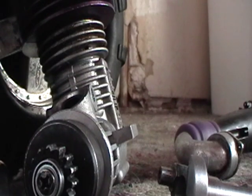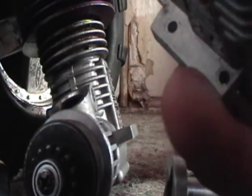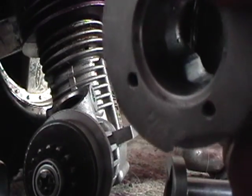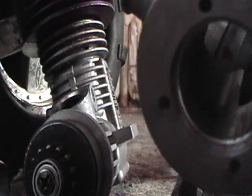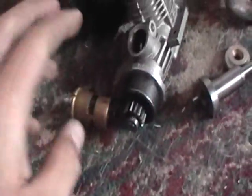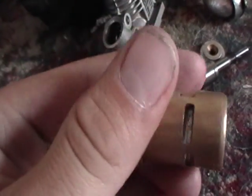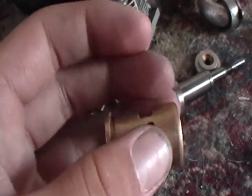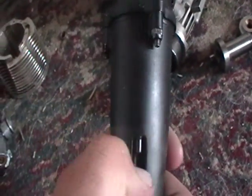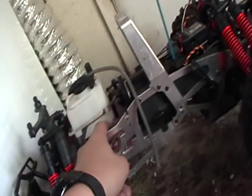For a block, this is your block. It's got support inside for the cylinder or sleeve, and it's got a hole for the exhaust. After the exhaust leaves the combustion chamber through this hole right here — these are the scavenging ports, this is the exhaust port — it goes through the manifold over here and then it bounces back, it echoes. Some of the pressure wave goes through this hole, in through this tube to the tank and out your fuel outlet a little bit, and that helps pressurize your system at high RPM.